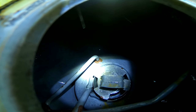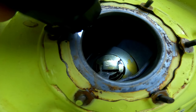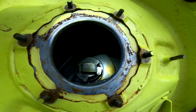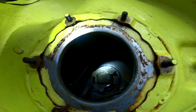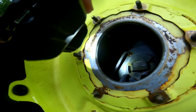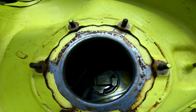I'm very impressed — it's very clean after just one round, roughly 24 hours of soaking. The camera doesn't do it justice, but all around the inside it looks great. The plan now: use muriatic acid, swish it around for about a minute, rinse very well with dish soap, let it dry, and then seal the tank. I'll do a bit of research to figure out which tank sealer I want to use.